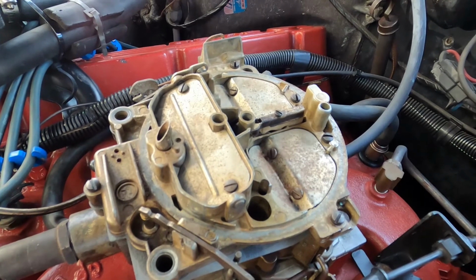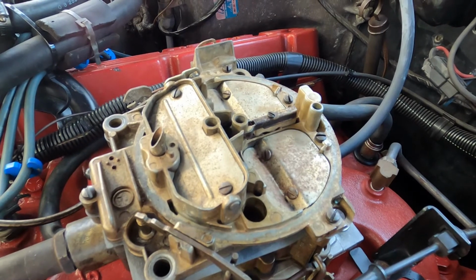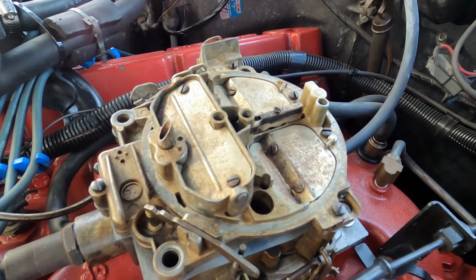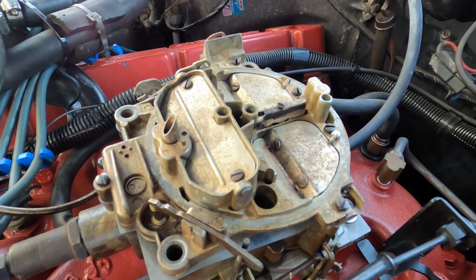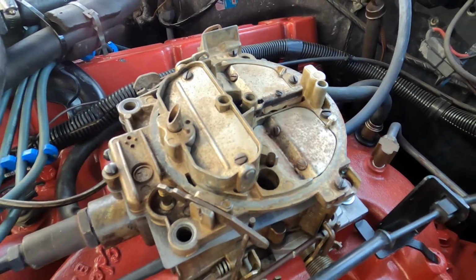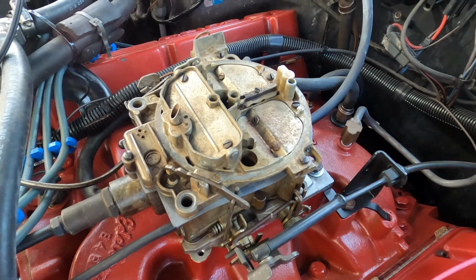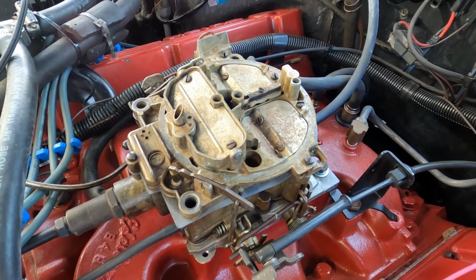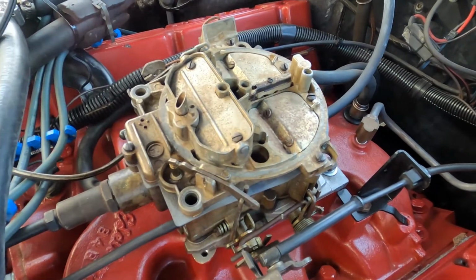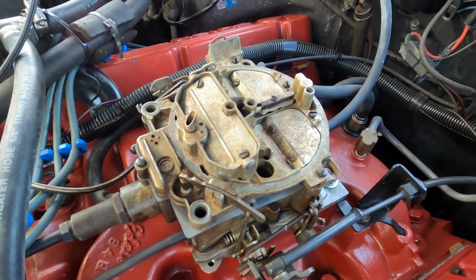I might go around like 4 times, just lightly snugging them, and you'll notice they kind of loosen. But you don't want to over tighten them. You don't have to torque the heck out of them. Just make sure they're seated, and with checking them the 3rd time or so, you'll notice if any of them settled in and were actually slightly loose. So obviously you don't want anything loose, but nice and snug. I go through them maybe 4 times, just making sure that none of them loosen up, because sometimes when you tighten a screw close to the other one, the other one loosens a little bit because it draws the assembly down. Good to triple check or more on these things.